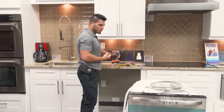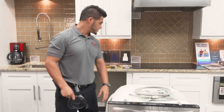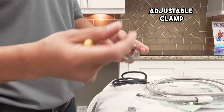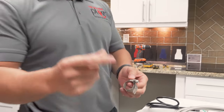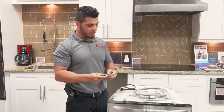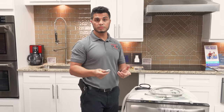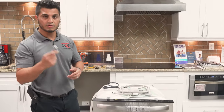One of the things you'll need for the drain hose is a clamp. Depending on your plumbing, your dishwasher may be draining into a connection under your sink or connected to your garbage disposal. I like this particular adjustable clamp because you can adjust it to fit either scenario — whether you're going to a garbage disposal or to a drain connection — and then tighten it down.